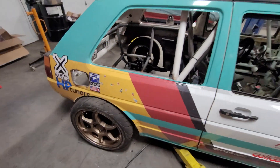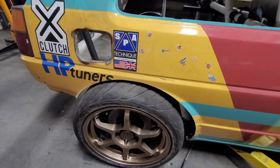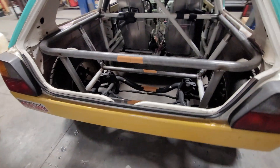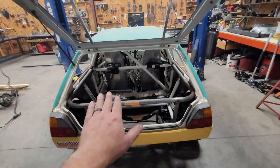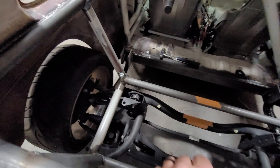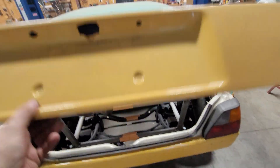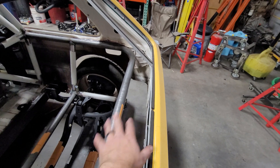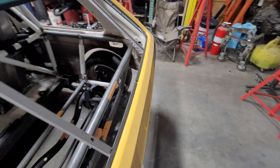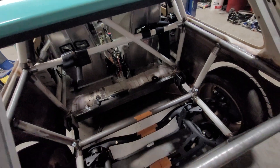Here it is. This is about the ride height. I've got to cut and trim this fender a bit more to actually get the bump clearance, but at least it clears the wheels right now. I believe that has good geometry for the rear, and then the front is really what is limiting it because of the front control arms. Here's a bit more of a review on the inside. I think it's looking pretty good. A feature wing or something like that can be bolted or welded right onto that tube. There is some additional bracing on the inside and I do believe the fuel cell is best served in that area — that void up front.